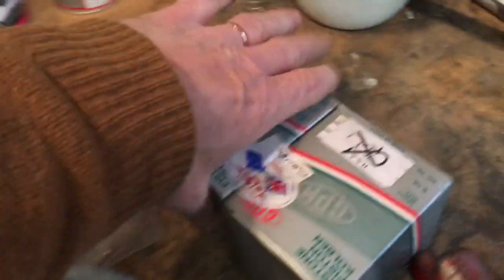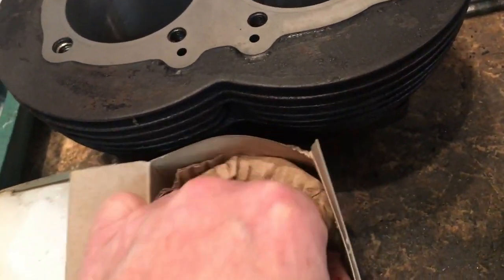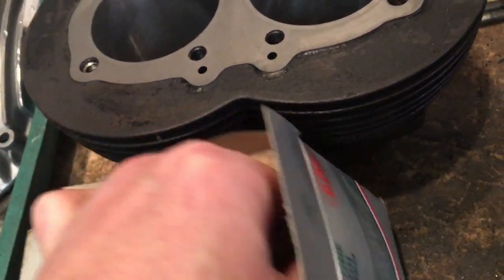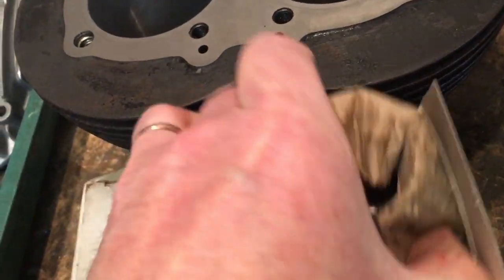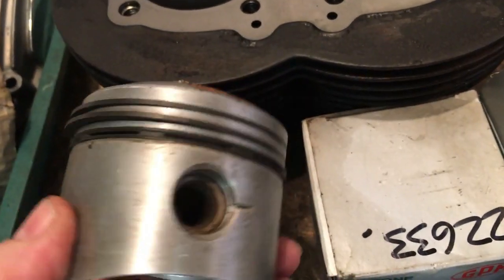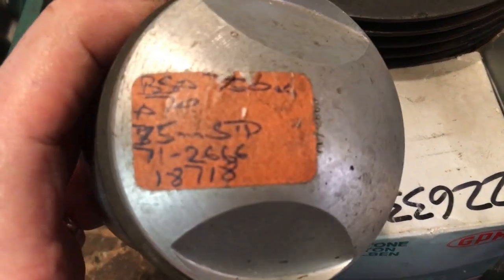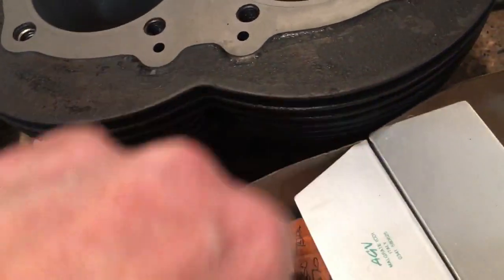Now what we've also got to do is the pistons. When I picked these up, I had a long discussion with Richard at Ward's Engineering. He said these pistons are within such a very small diameter tolerance that it doesn't matter which way around we insert them, so they're not labelled left or right. They're in very good condition — brand new standard A70 pistons, part number 712666. However, one of them has got a slight burr on the lower edge.